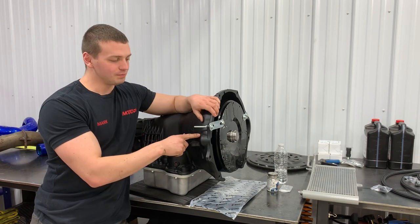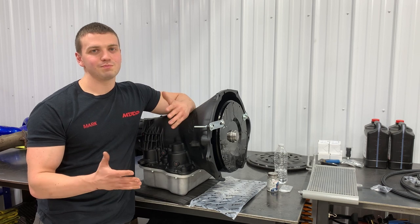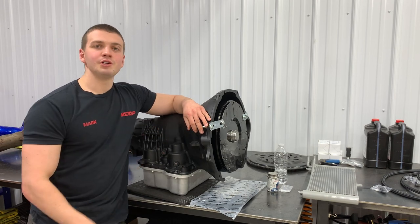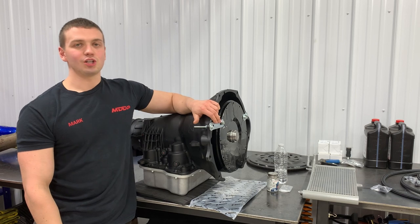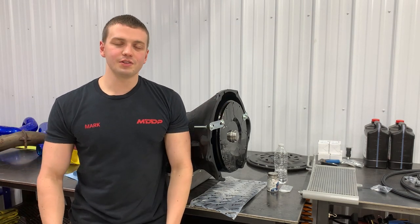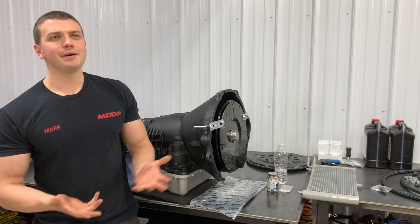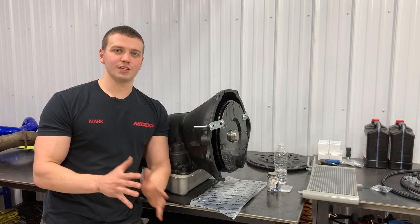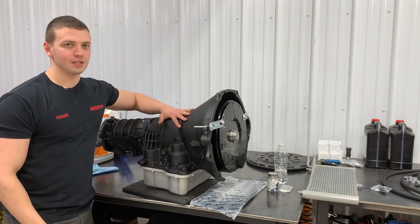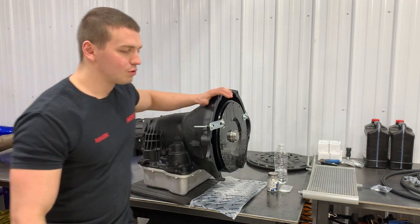The first to go is the input shaft — do that if you plan any towing or put any power to it, it's a good starter upgrade. The second is the output shaft — if you're doing boosted launches or racing, that puts a lot of stress on the output. The intermediate shaft is the strongest of the three from the factory, but once you eclipse 750 horsepower, that one likes to shear. For my truck — it's a little hopped up with a turbo and injectors but nothing crazy, it's a 2001 — I only did a billet input shaft. The internals are rated for 1,500 horsepower, so just get a billet input and let's get to work swapping parts over.